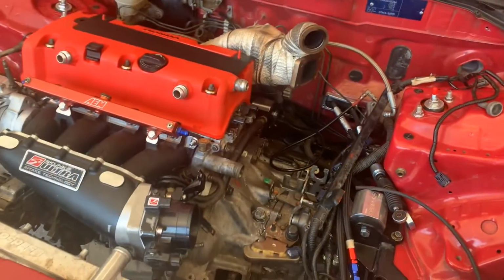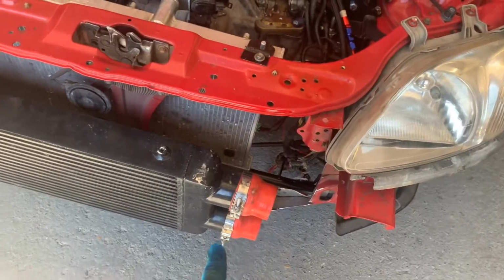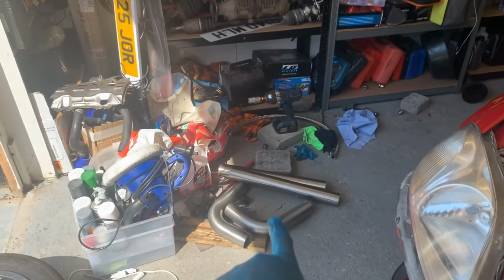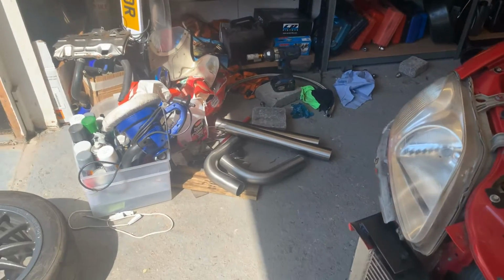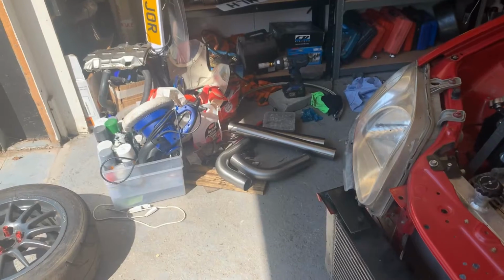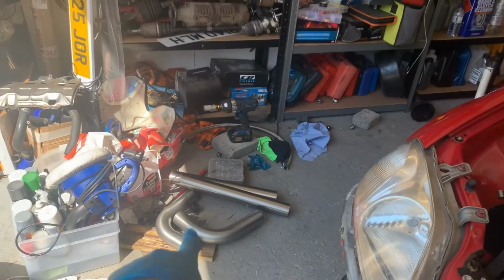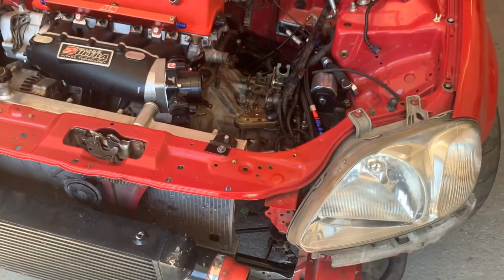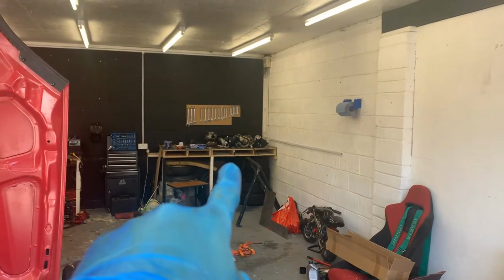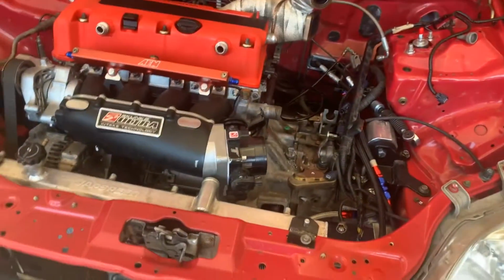And maybe if there's enough time, start getting the boost pipes done. As I've dug out, yep, it's stainless. I know most people use aluminium. It does not really matter. Aluminium's lighter, obviously, and if you can weld aluminium, it's easier. But unfortunately, I can't, and I've got these in stock already. So I'm going to be using them to make the boost pipes and go up, and then I'll have the top ones as alley, as my old one, because obviously my old one's got the methanol fitting and the dump valve in and things like that.